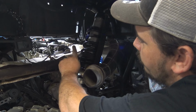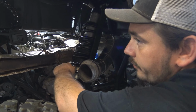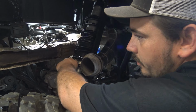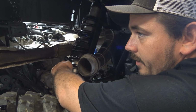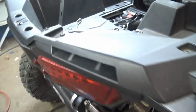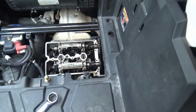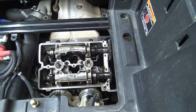So now I'm going to go ahead and pull each cam completely off, and then that gives access to the head bolts that are not accessible. That's the whole point behind this is, you can get to some of the head bolts, you can't get to all of them. Yeah. So you have to pull the cams. You can see up here, you got access to the left two, and looks like none of the others.